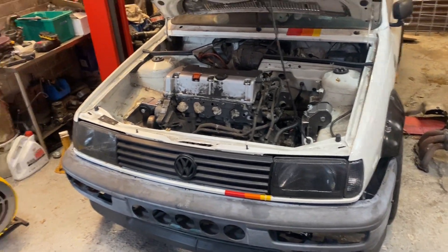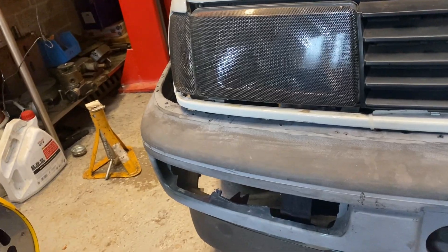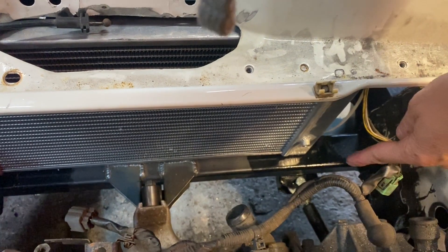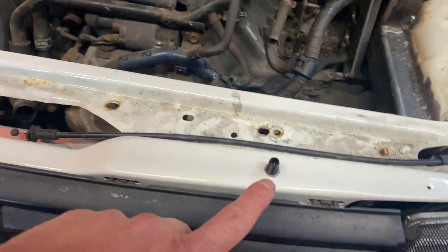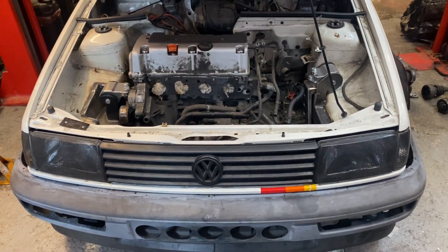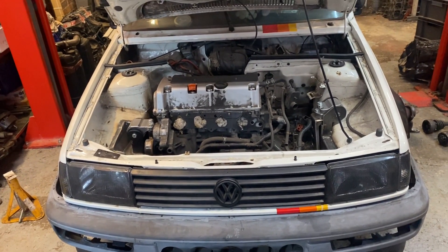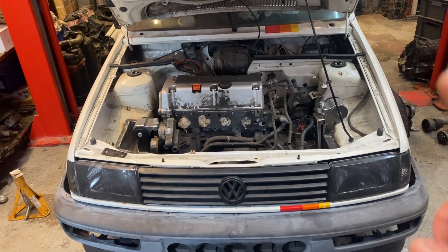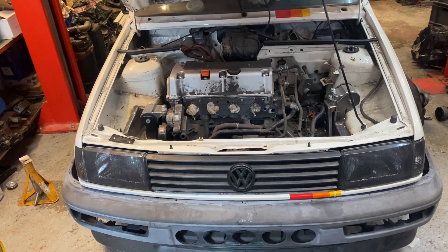So it's back together, back on its wheels, ready to roll — everything seems good, everything moves, everything clears. The radiator's in — we've just drilled a hole in the new cross member either side to locate it, and we've put two little locators in which hold the top of the radiator so it all fits and sits as it should. The sump's got clearance, the tie bar on this side's got clearance, everything is in there and everything seems to be done. Let's put the bonnet down and double check everything moves and clears, and we'll wrap this one up.